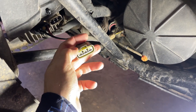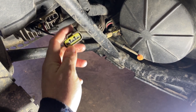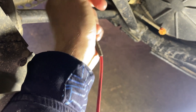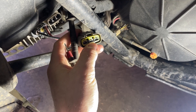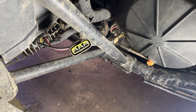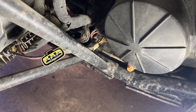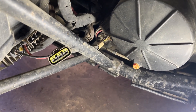The regulator is good. For the stator check, there are three terminals. Take your voltmeter, put it to AC volts, take your two leads, and probe between terminals one and two, one and three, and two and three while it's running. You should have 20 volts at idle, and when you rev it up you can go up to 60 or 70 volts. If you're getting less than 20 volts, the stator is likely bad. We'll fire it up quick.